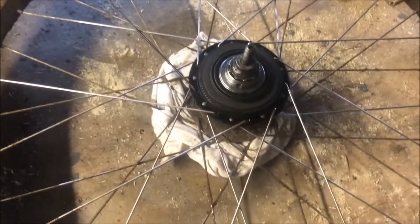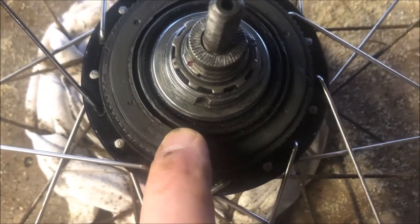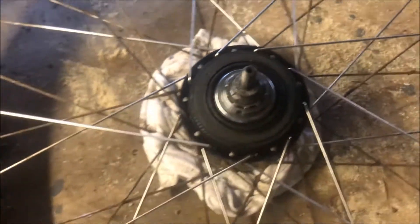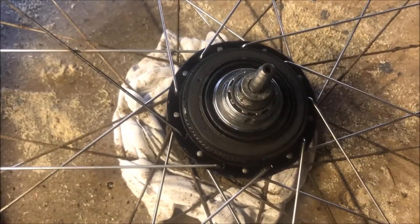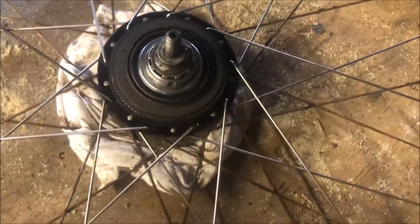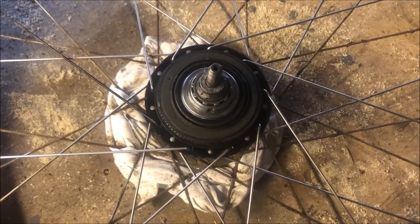When we're inside, I'm guessing I'll find hardly any oil because I had quite a large leak the other day — it dribbled out. You can see on the back of this guard plate there's quite a lot of oil. The guard plate sits over this join here, so if that's a seal, perhaps that's where the leak's coming from. There's about 25 ml of oil in there, and the other day it all ran out onto the chain, went along the chain, went all over my trousers and my shoes. I had to throw the boots away actually — they were nearly had it anyway, but it was a bit annoying.